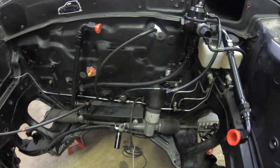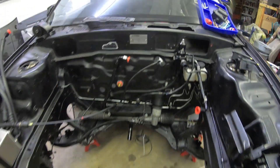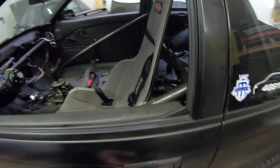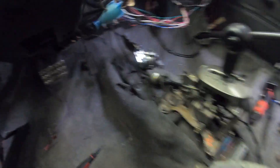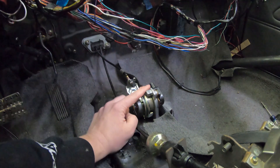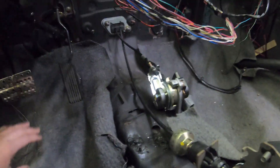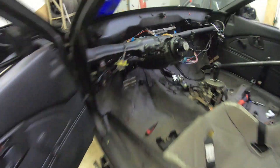Last thing - this has been in for a little while, but this is a cable throttle going to an actuator inside. That's actually a Mighty Max cable throttle that my buddy Matt suggested to use. It fit pretty good. So we've got cable throttle going to this actuator that'll obviously be wired to the MoTeC. Instead of using a regular drive-by-wire pedal, you can actually just use the actuator and use your factory pedal - kind of like that setup, a little bit easier than trying to fit a big bulky pedal in there.